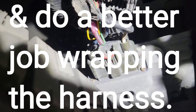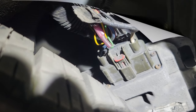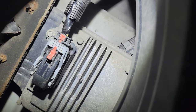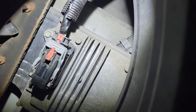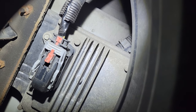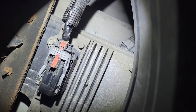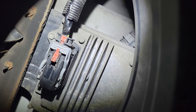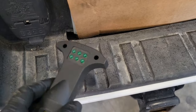For the next connector, you'd have to drop the spare tire for good access. If you go underneath, you can look right through the spare tire wheel and see that other connector. I actually had a broken wire going into that one that I repaired — you can see the fresh tape there to keep everything dry. Give that connector the same treatment: check for visual damage, corrosion, and dirt, then undo the connector and look at both the male and female ends.